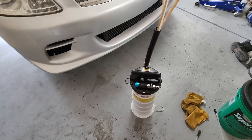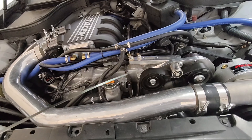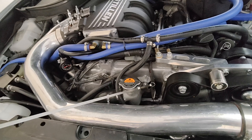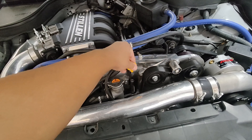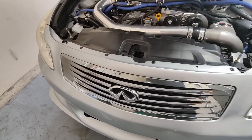I know it took a long time to figure out how to pump the oil out of the engine, but I did explain to you why and how it works. What you have to do is keep pumping — once you see the oil come, let that siphon, and once it loses pressure give it another pump or two to get it going again. That's how these work, unless you use the air accessory — you can connect it to a compressor and once you let air in it's gonna suck it out on its own. Anyways, let me go ahead and put the dipstick back in and we're gonna go underneath and take out the oil filter.